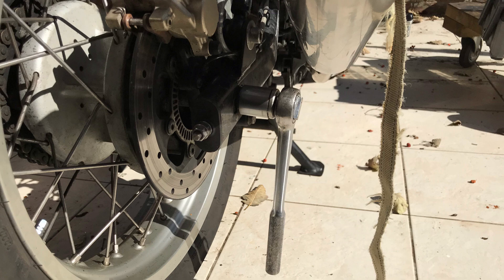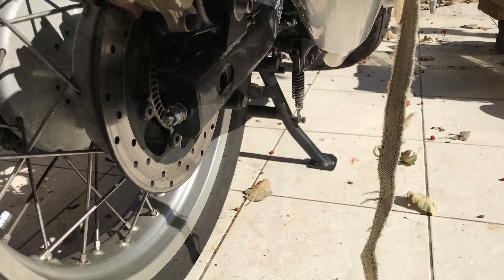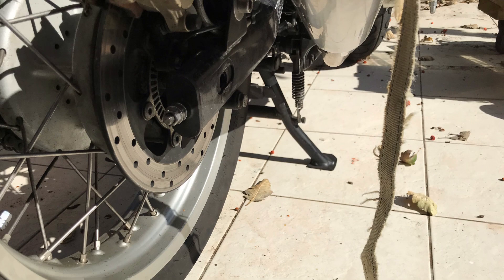Then it's a question of pulling out the axle. I've pulled it out left to right. If you get a pair of pliers on the end of your stock chain tensioner, around the nut or wherever, and just pull it or give it a tap with a hammer, it'll pop out - the little plastic ends that the stock tensioners have got that fit into the end of the swinging arm. They need a bit of a pull.